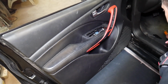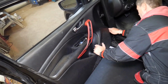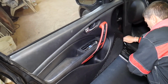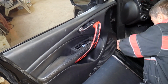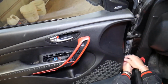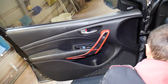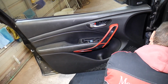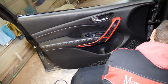Perfect. Now we get a plastic panel removal tool. We should have only the clips holding that in place. So what we're going to do, actually, we're going to get it between the door panel and the door itself. And you need to pry. Okay, perfect. Now if any of the clips break, it could happen, guys, especially if they're super tight, or sometimes if they're old, the plastic will be more fragile. We'll have the link in the description of the video below to see where you can buy new ones from.